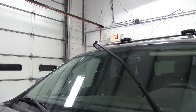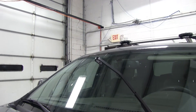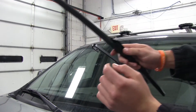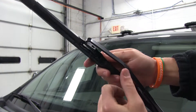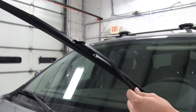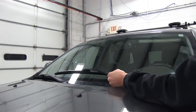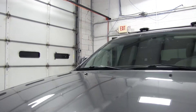With the J of the wiper arm freed up, we're ready to install our new Michelin wiper blade. We'll take the center of the wiper blade — there's a convex piece that's basically going to slide right into the J of the arm. Slide that in, you'll hear a click, and then we'll slowly place it down onto the windshield. We'll go over and repeat the same process for the passenger side.